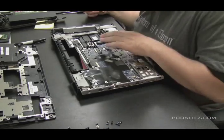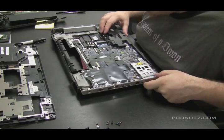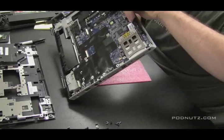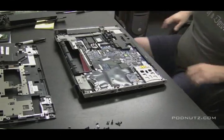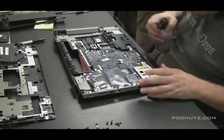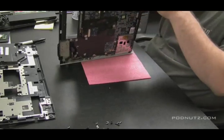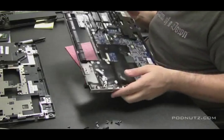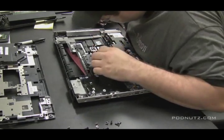If you see the black sticky tape on top of the motherboard, it's also a good idea to look under parts of that too for corrosion when you're trying to determine whether liquid got onto the motherboard and did some damage. Water seeps into the craziest places. That black thing I'm taking off is the speakers. I'm going to hit everything with some compressed air — any place you see dust or dirt, clean it up while you have the chance. Speakers tend to get a lot of stuff in them because they're exposed to the outside through the speaker grate.